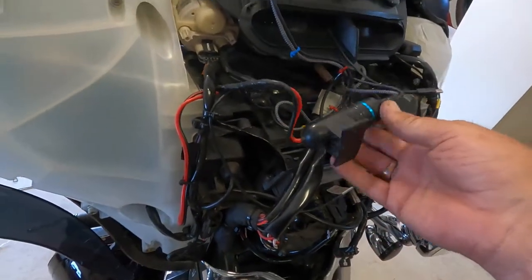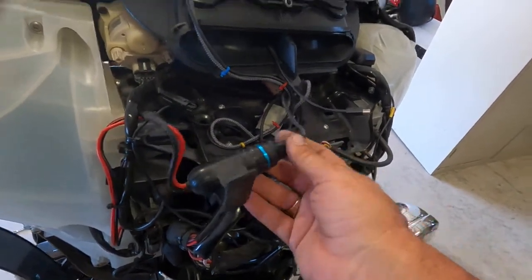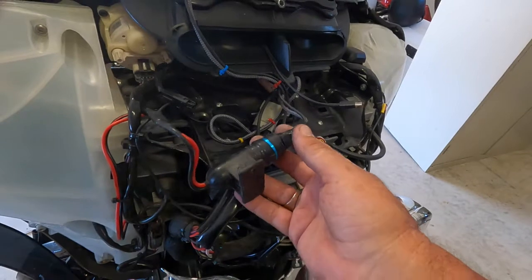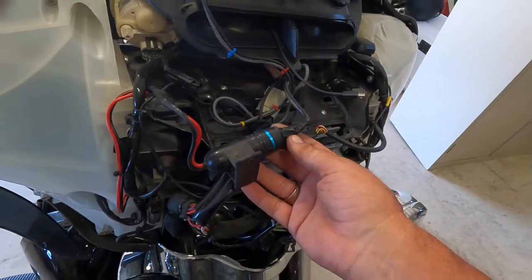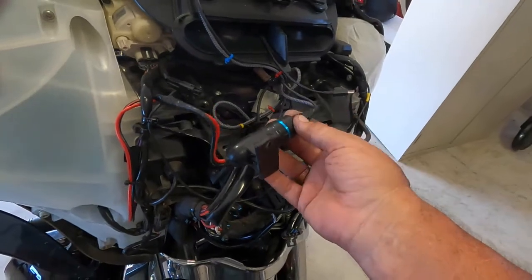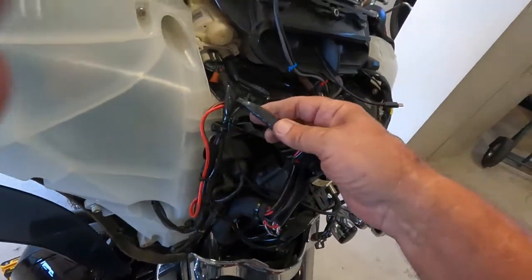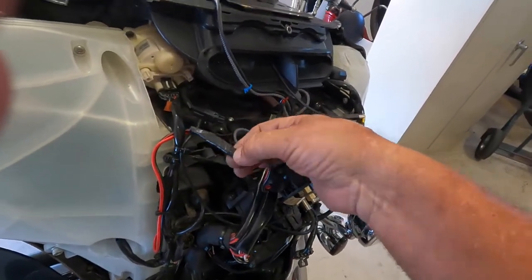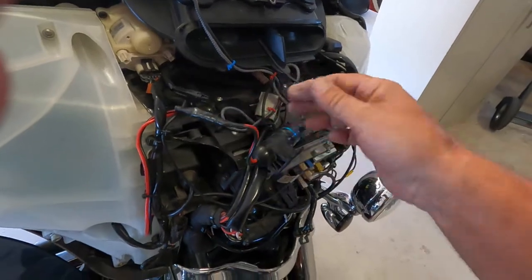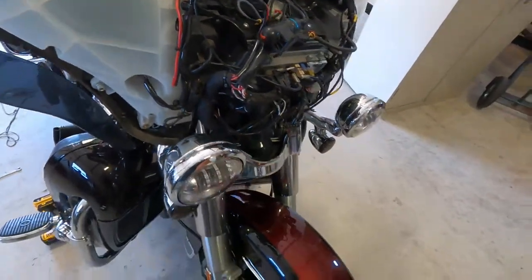So I'm going to go ahead and probably replace all this electrical tape here that's holding all the cores together because I was losing contact at times going down the road and it was stopping my recording. So I'm going to change this all out, and then I'm going to separate my wire here. See, I've got a butt connector here already, so I might just separate the wire right here and then tap in my new wire onto this. We'll run it down through the fairing.